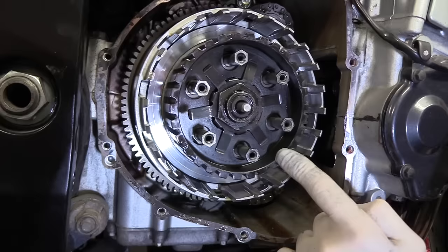Okay, I'm gonna pop them down this end. You can probably see straight away, they're made from slightly thicker wire. We'll just take that one. As you can see, thicker wire and a little taller and fewer coils than that one. Thinner wire and definitely softer, definitely. So what that's going to give me, as that's a heavy duty spring set, it's going to give me a little bit more beef at the lever.